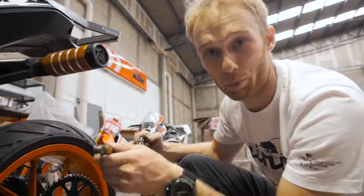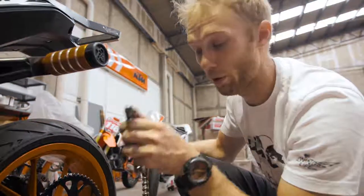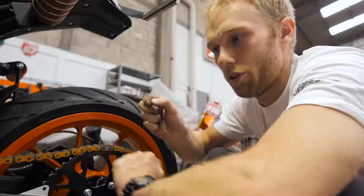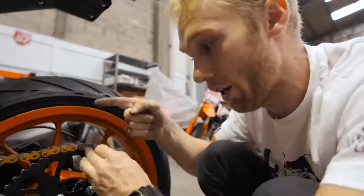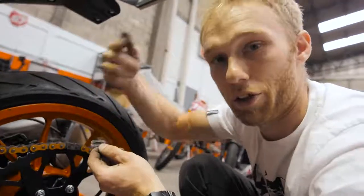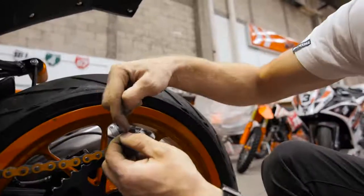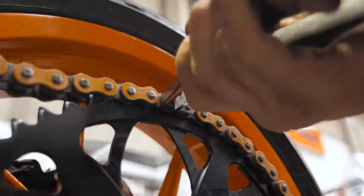So I'm gonna show you how to properly mount a chain — that's the rock-on tech tip. There are millions of ways to do it; I do it like this. I remove the chain guard so I have easier access. The last thing is to put the pin, the safety pin. The chain is going this way, and if the pin is facing this way, it can hit an obstacle when it's turning, the chain can fall down, and you can crash. So the simple thing: you turn it in the opposite direction. If it's still hitting something, it will not fall down. Put it like this. Perfect.